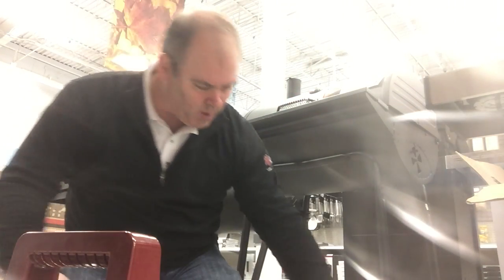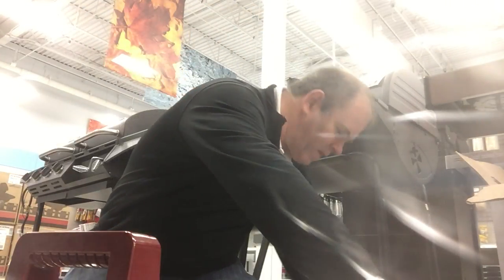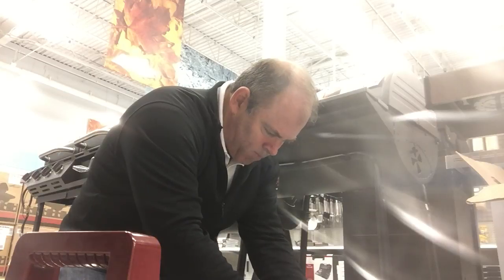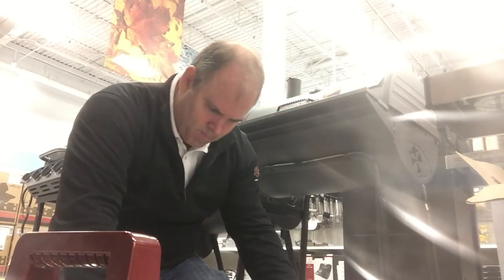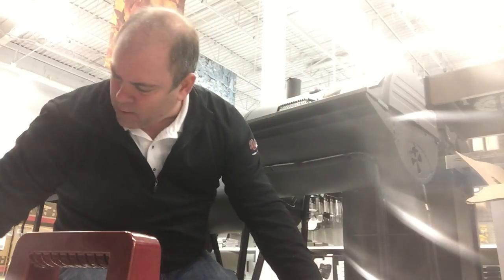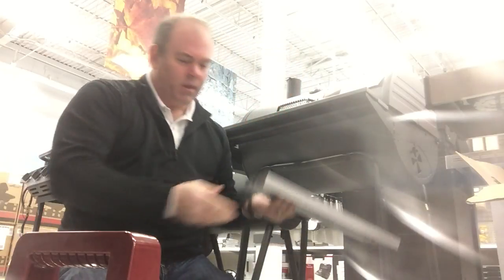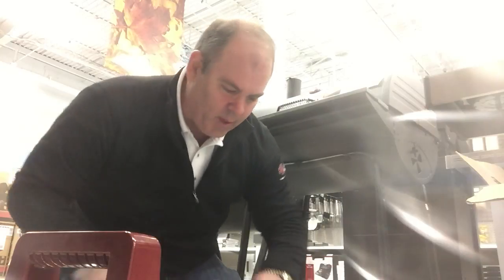Side, clean up a little. Put our other side handle on. You can obviously put this on earlier. I was just trying to get through this demonstration as quick as possible, so the MPEG isn't too big. Once we get these two tightened down onto the screws, again we'll use, I believe it's a 5/16 socket to tighten those all the way down. The heat shield I put on this side first. There's two semicircles on the other side, so that will allow us to see the other bolt, and then it just shifts over and that holds it into place.